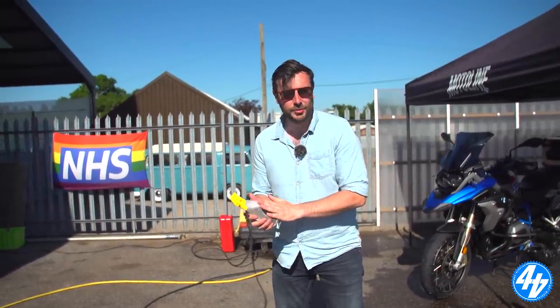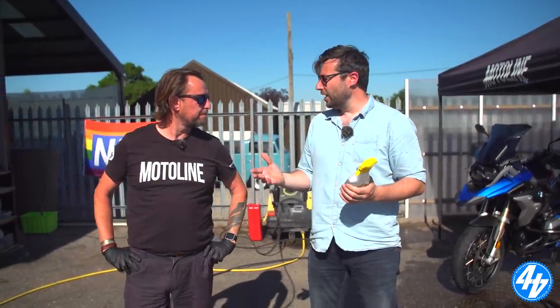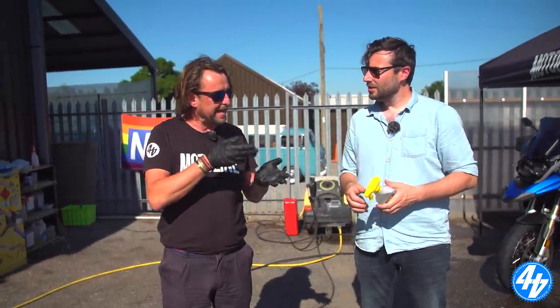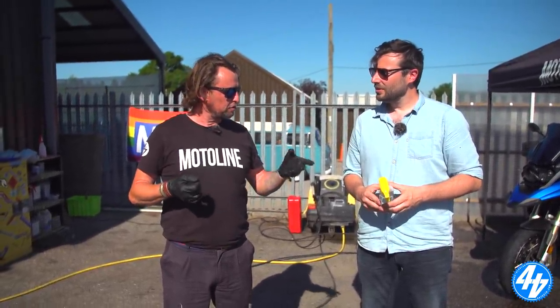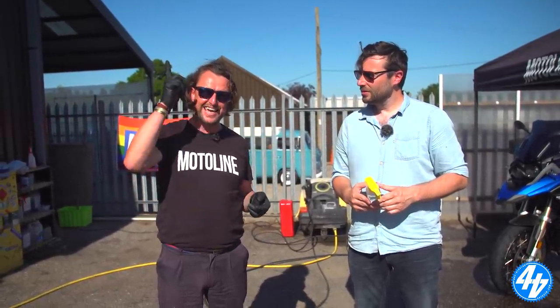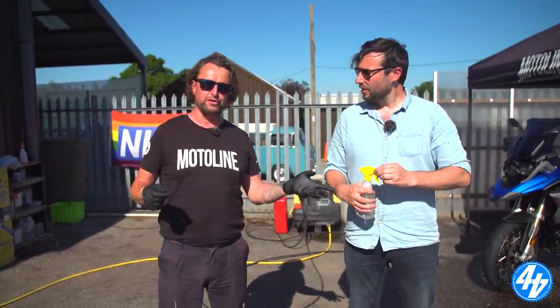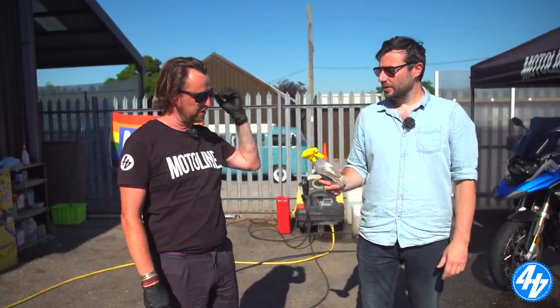So we've got a bit of a range here. Regardless of WD-40, whatever product you use, you've just got to use your brain. Just be sensible - don't use chemicals on metals, on alloys. Read the instructions and do what it says on the tin. However, in the heat we've got at the minute, don't put stuff on and leave it and walk away. It says two to three minutes, but in this heat it'll stick on the bike and could damage the materials. Common sense prevails. Keep it simple.